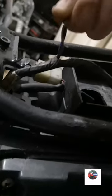It's still sparking there. Let's see, I'll join these two wires now, and then I'll join them for good, because that's how they're meant to be. If you haven't got the side stand down, the switch joins on down here onto this bit. That's the side stand wires joined. You can tell that's a much better spark.